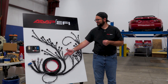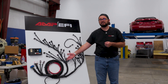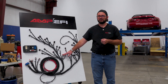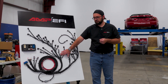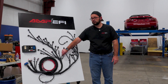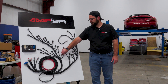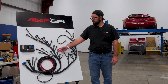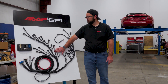The alternator is done the same way — you can add an extension harness on here too. There are a few different mounting options for the coyote alternator, such as top or low mount if you've got a coyote out of a truck, so we put this on a plug so you can choose where it goes. A lot of people are running one-wire alternators and don't need this control — in which case this outputs 12 volts and PWM, and you could use it for a boost controller if you'd like. We also have a plug called flex and fuel pressure, so you have everything necessary for a fuel pressure sensor, a flex fuel sensor, or any other sensor you'd like to wire to this.